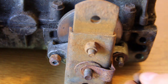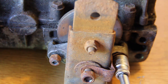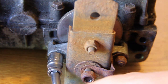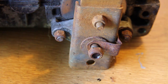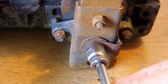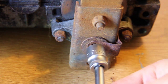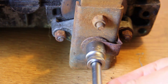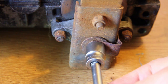Then finally you can put the two locking nuts on. The two socket sizes I've used here are 10 and 13. This final locking nut you'll have to fine-tune because sometimes you can overdo it and the brakes are too hard, or you can underdo it and the brakes are too soft — so you'll just have to play around with that until you've got it right.